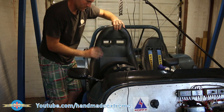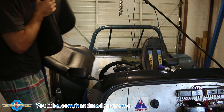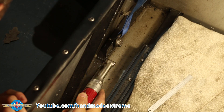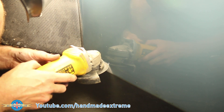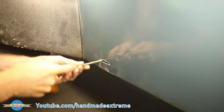I'm going to make a new bracket that pokes through the bodywork and is welded to the chassis on the inside. So to do that, I first needed to remove the seat. I drilled a couple of pilot holes through the bodywork using a small right-angled air drill, then joined the holes together using an angle grinder with a slitting disc to make a slot. A couple of small files made light work of the aluminium bodywork getting it to final size.